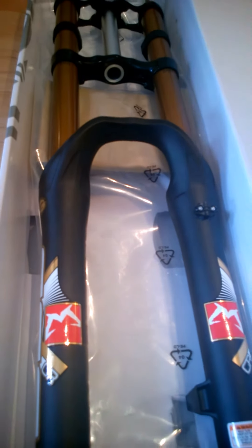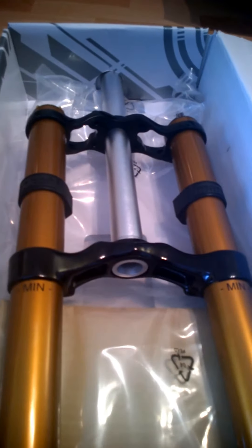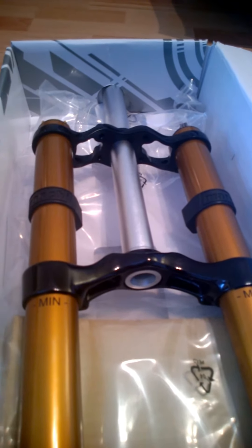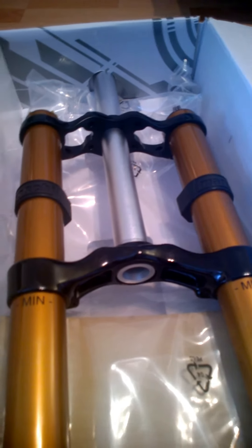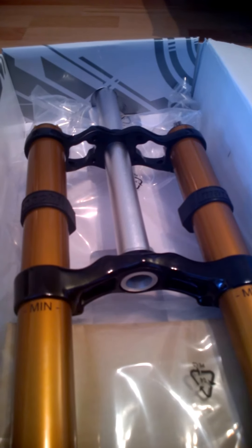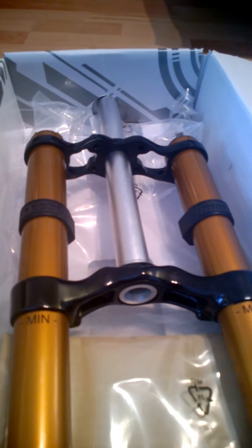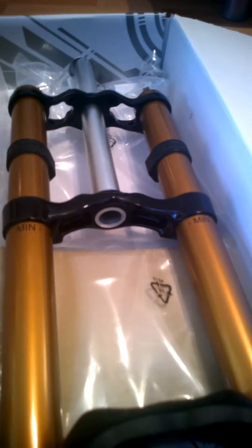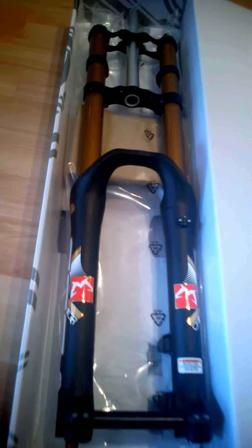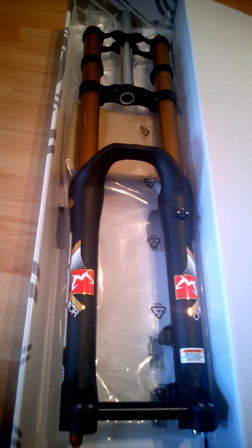The box itself only comes with the starfangled nut, which is in a little box up in the steerer. I'm using a threaded nut that goes through the steerer — a sort of preload headlock system — so I won't be tapping the nut into the steerer myself. It's a slightly heavier system but allows more flexibility, especially when taking the fork off or reselling it, as you don't have to leave a starfangled nut down in the steerer. Not much more to say — I hope it's of some use. If there are any questions about the fork, just let me know in the comments, and I'll catch up soon.